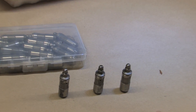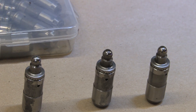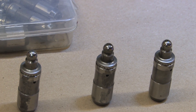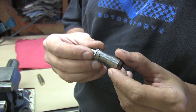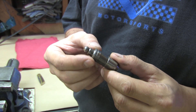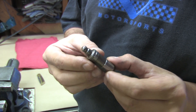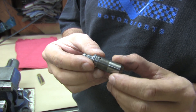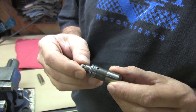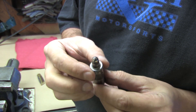These are a few crusty old first generation lifters. Over time, hydraulic lifters can become clogged with sludge, or worse, filled full of trash. Mitsubishi has revised these parts three times during the life cycle of DSMs, and there are easy ways to identify them. They have bottle cap style caps holding the lifter assemblies into an outer sleeve, and they receive oil pressure through a hole in the side of the sleeve. There's a check valve that traps some of the oil in the bottom, allowing them to expand and fill the gap.